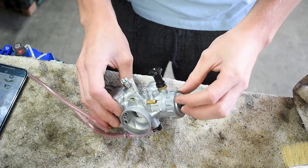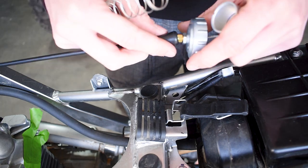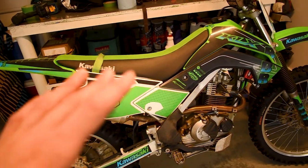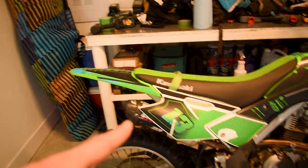If you're going to be doing the big bore kit and these upgrades, you're going to need to swap carburetors. The factory carburetor is only a 20mm — really tiny, even for the 140cc. We've ended up sticking a Mikuni VM26 carburetor on there. There is a carb conversion kit, also listed below, that you'll need to adapt the VM26 onto your KLX 140. The conversion kit comes with adapters for the intake flange as well as a conversion throttle cable. One of the things that plugs this bike up and stops it from making power the most is the exhaust — we have the BBR D3 carbon fiber exhaust, and this thing is absolutely sick. This bike really does start to sound closer to a 250 than a 140 with all the upgrades.